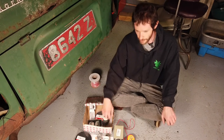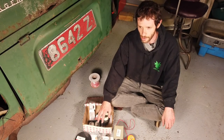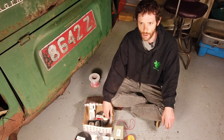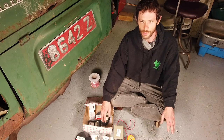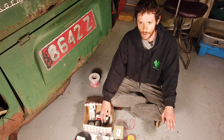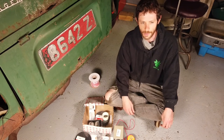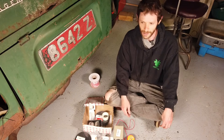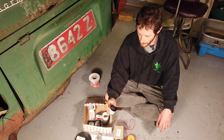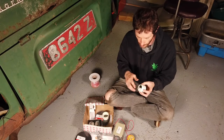I'm well aware that these gauges are not the most accurate in the world. They won't give you a true picture of the state of your engine, but they give you a good baseline so you know what's going on, you know what's normal in your engine, and if you see the gauge going above normal then it's time to ease off or go into a lower gear to increase the fan speed and airflow and cool your engine a bit better. So I've got a temperature gauge and an oil pressure gauge, both of which I'm going to install today.